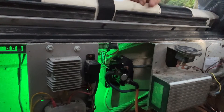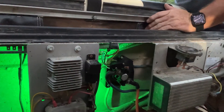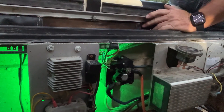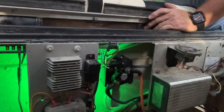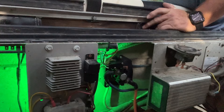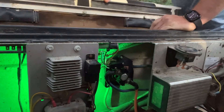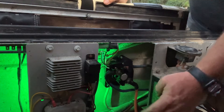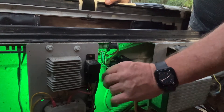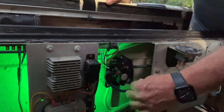I got the switch back on the cart and we now have reverse, and we now have forward. Cleaning those contacts up — although the switch was damaged from heat, we were able to successfully clean it up and polish up all those contacts. I do see some other issues here: I need to redo the ends of both of these wires. They're still covered, but there's some swelling going on. I need to clip these off and hydraulically press on some more fittings.